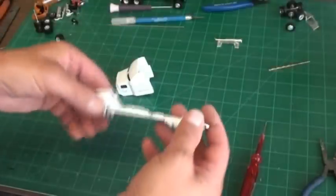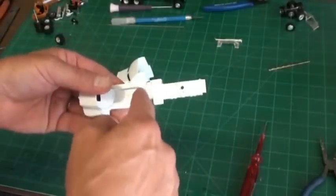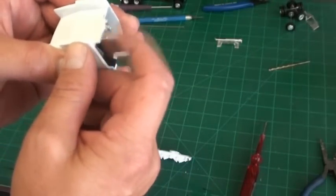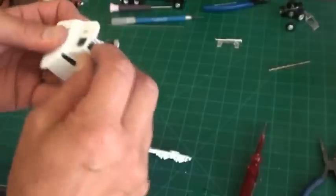The lower part of the cab body will also need to be shortened. On this model, I cut right behind the hole where the exhaust came through the frame. The part does not need to be this long, but I prefer the fit and finish at this length. Plus, it gives a solid place to match the exhaust again.